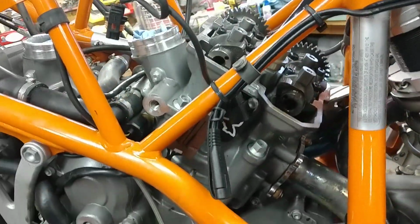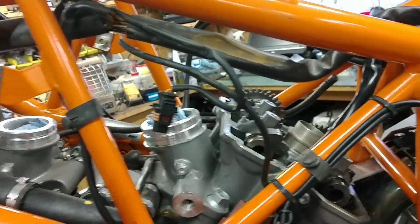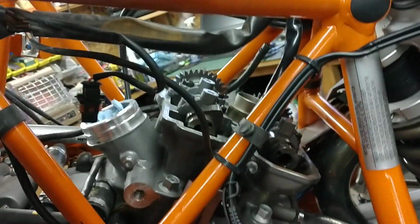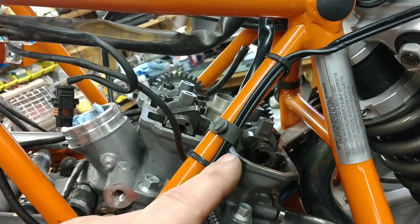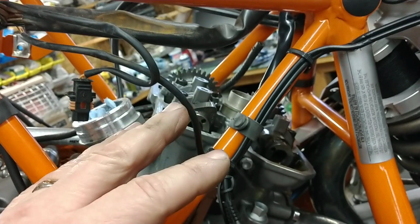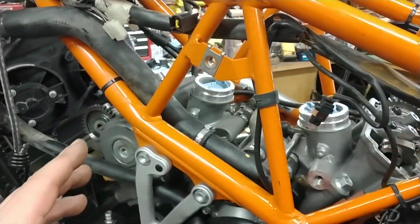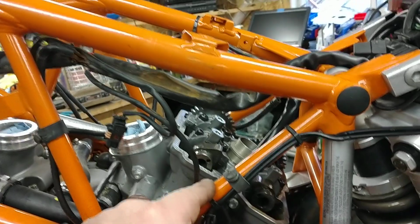And you'll notice that the motor wants to turn when it's at TDC because there's pressure on the springs and it wants to settle to a point where it doesn't have any pressure on it. So I bring the cylinder back to TDC using the screwdriver down the spark plug hole method. I would put my shims in based upon the measurements that I made previously, put the buckets back in, everything, cams, bridge, bolt everything back down, torque it, and then I would cycle the engine through 360 degrees, and then go back and double check that the clearances are within specification.